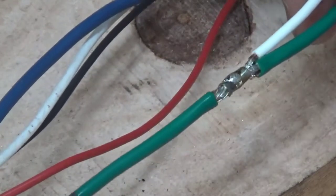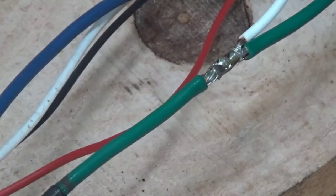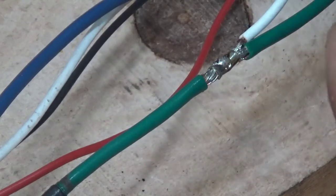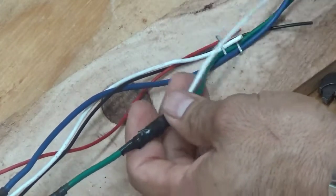And there's a good accessory wire you just added without having to cut the main wire. The only problem with this kind of wire repair is you can't put a shrink tube in there. Because you didn't cut that main wire, there's no way to sneak a shrink tube in there, so you'd have to follow it with just regular electrical tape. But because of the splice clip and the solder, it makes a very strong connection. That's the first kind of wire splice — very useful when you don't want to cut the original wire, you have voltage going through there and don't want to cause an excessive volt drop, or in a situation where you just want to get in and out quickly.